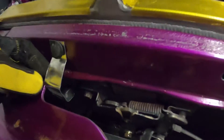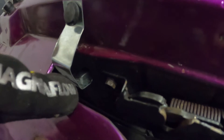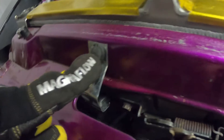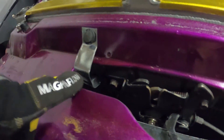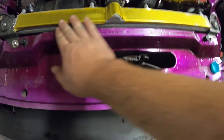As a test I made this little piece right here out of aluminum, and it has a washer sprayer attached to it that's aimed towards the radiator. I can bend this to get the right aim that I want, and I'm probably going to get something nicer to actually tighten it against the rad support. These holes were existing — I just drilled them out a tiny bit bigger — and I'm going to make a second little aluminum piece to hold the washer sprayer for this side. This will spray the radiator towards the hot side.